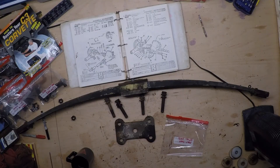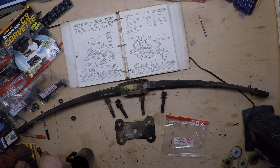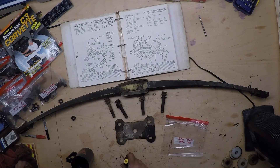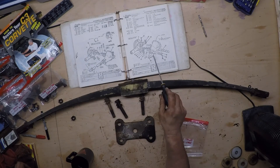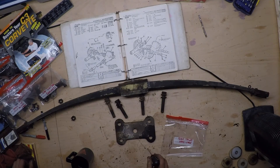Quick review on the rear spring assembly: we had to jack up each side of the spring to take the tension off before removing the bolt that held the shackles in place. Then at the center section, we have our plate and four bolts, and everything came off pretty well. This is all illustrated on page 181 of the Corvette assembly manual. If you like these videos, please give me a thumbs up and subscribe — thanks so much.